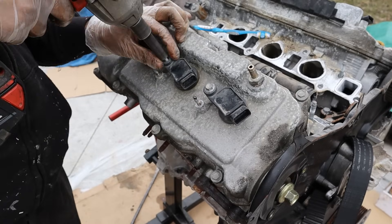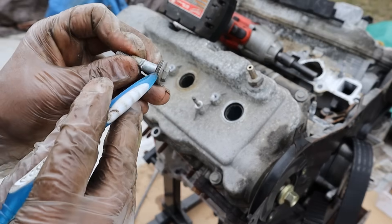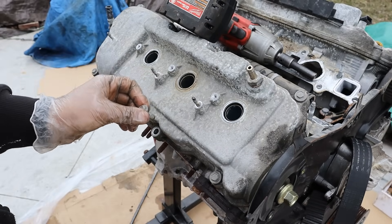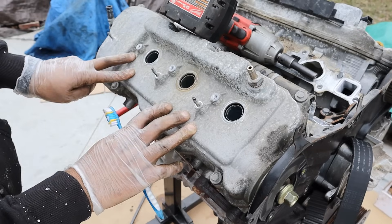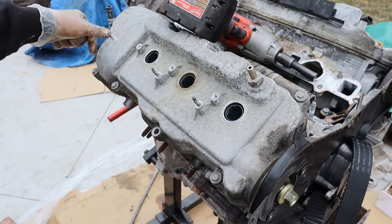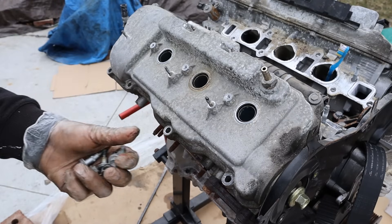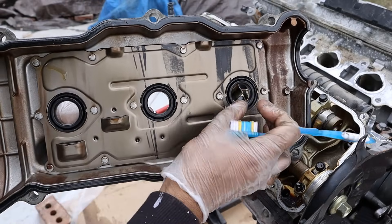I'm going to start removing the valve cover. These bolts are pretty interesting — there's actually a crush washer integrated into them, so they're kind of a one-time-use, but you can get away with adding a 5/8 washer to space them out when replacing the valve cover gasket. Valve cover gasket leaks are very common on these engines. To get to the back valve cover you have to remove the entire intake system — it's not an easy job, plus the wiring harness gets in the way. Another thing is that these bolts actually get pretty loose, and that's probably what causes the leak, so if your engine is leaking you might want to tighten them all down. If your spark plugs or ignition coils are wet, it's due to these tube seals that you have to press in and out.